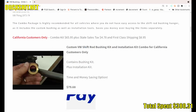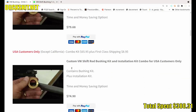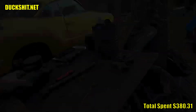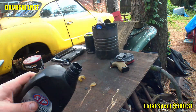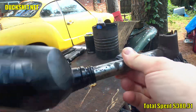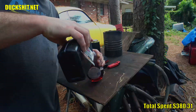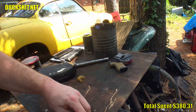There's a brass bushing that someone else makes, but it's a little expensive in my opinion, and it's just plain noisy — in the fastback I can really hear the shift rod transmit engine and driveline noise into the cabin when the bushing goes bad and it's metal-on-metal contact. On the ATVW that noise probably won't even matter anyway, but this project is meant to be built from junk so it's not in the budget. I messaged Wild Bill to see if he had a stock nylon bushing, and sadly he did not, but he shared with me the method to make one from the top of an old oil bottle. I came across an old bottle of Dexron, saved the fluid in another bottle, and then this bottle donated its neck. That suggestion saved me money and time — perfect for this project. Thank you, Wild Bill.